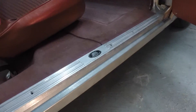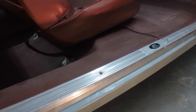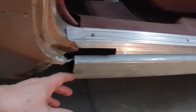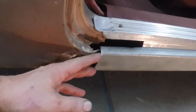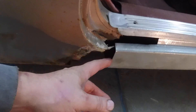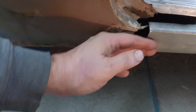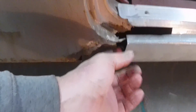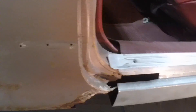I fixed the inner and outer panel. It's just tacked on — this weld will be under the sill plate, and the other welds will be underneath the car, so you won't really see any of the welds on the rocker panel. There'll be no filler there; maybe just a little right where I transition from the quarter to the rocker, since sometimes they're not exactly perfect.